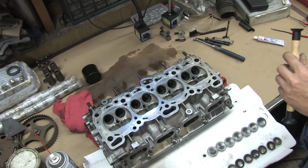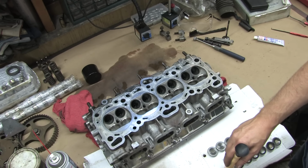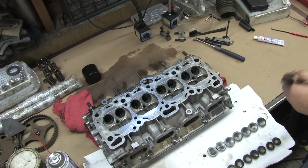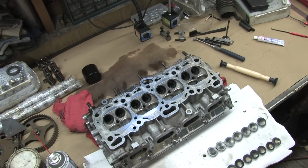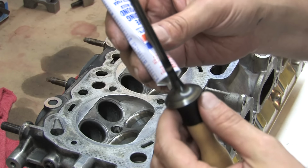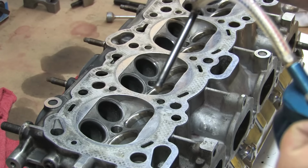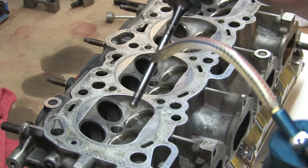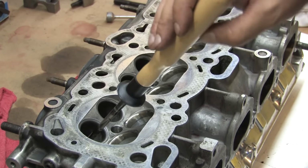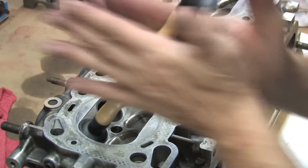They're supposed to stick to the valve, but once you get one grain of lapping compound on the sealing edge, not even the expensive ones like to stick until you clean both surfaces. I've heard of people using chewing gum, spray adhesives, and more to make them stick, but really, you're better off just putting up a fight and not letting it win. The application and cleanup with adhesives and other kinds of tricks, that takes time. Using the lapping handle, you can apply force only to the face of the valve, evenly and only where it needs to be. The result is a flatter, straighter seat for both novices and pros alike.